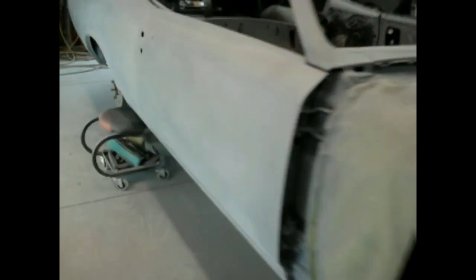Like I said earlier, I had a couple places on the car, just right there, a little bit showing through, right there. We'll touch those with the primer in the gun. And right here, again, I used the long board on this. I didn't like what I had there. Opened that up, and right here, I didn't like how this transition was, this curved transition. So I sanded this down some more. I like what I have with it now.